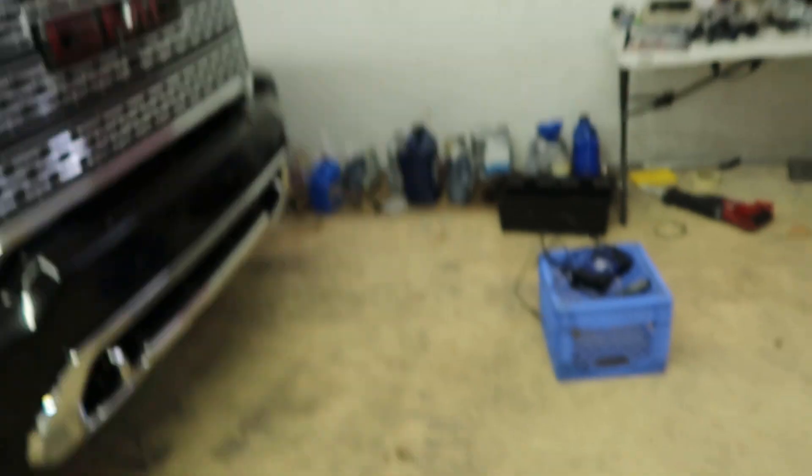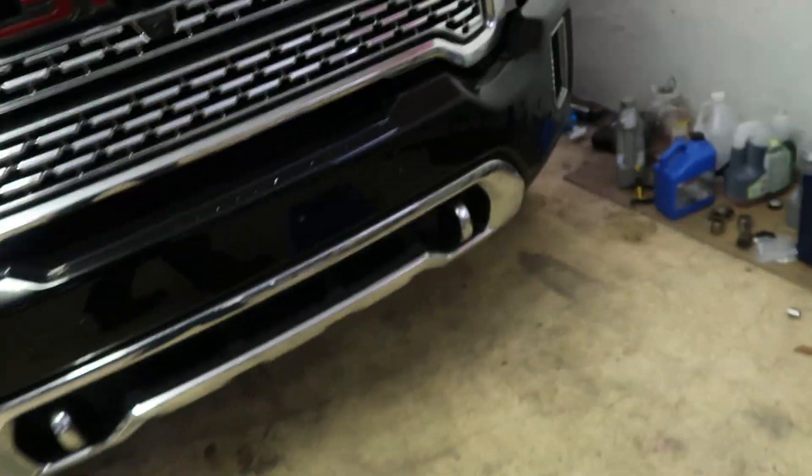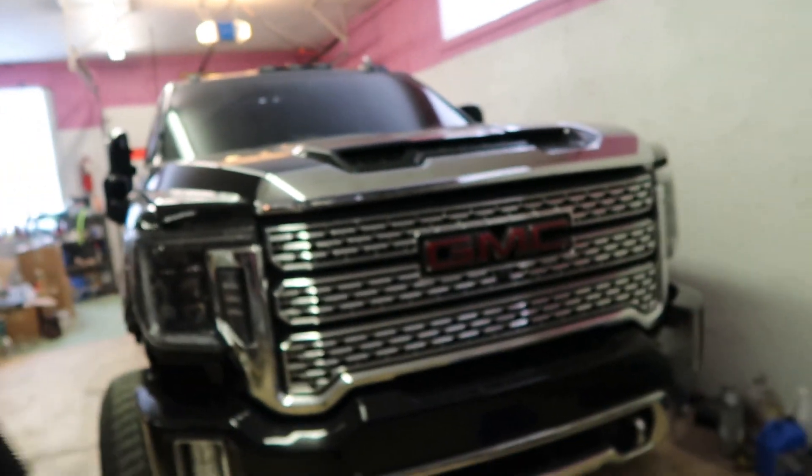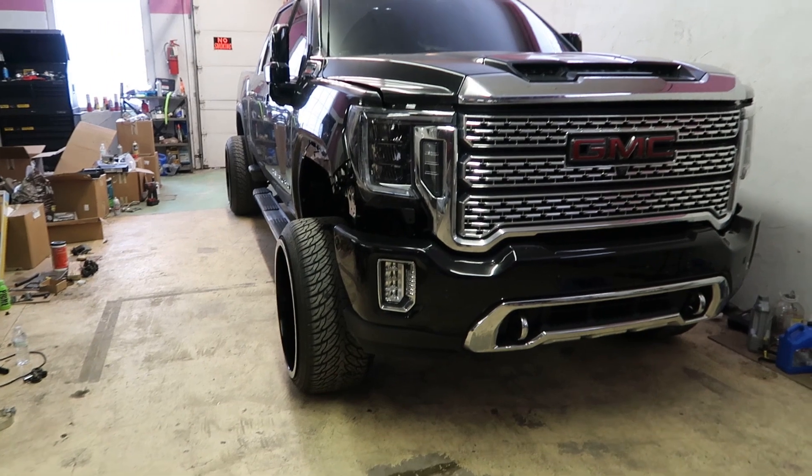Come to find out, for whatever reason these aftermarket turbos are causing the vanes not to relearn the way they should, and the truck is going to drive a lot better after you do a vanes relearn procedure. So basically that's what I'm going to do today — use my MDI 2, hook it up. GM came out with a whole new software platform; it used to be AC Delco's login but now they have Techline Connect. We're going to run through the vanes relearn procedure, see if we can get the vanes to relearn, hopefully make my turbo run the way it should and get the messages off my dash.